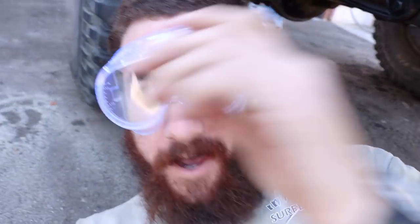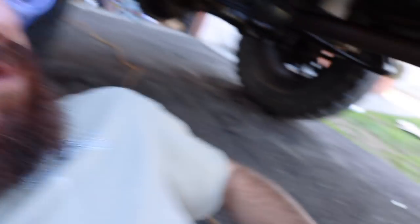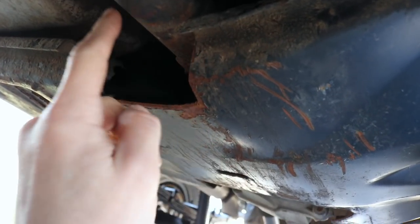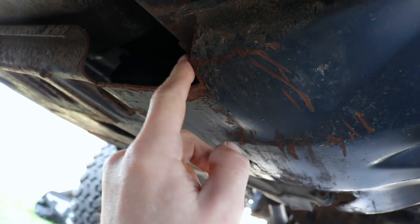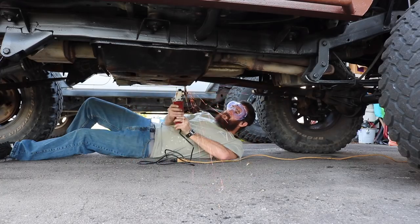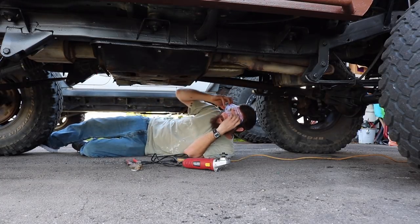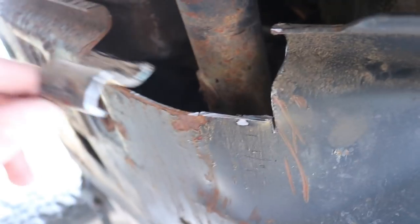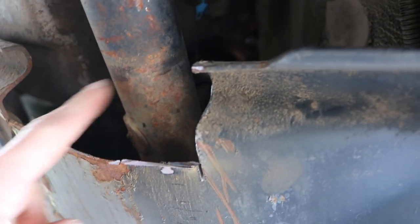Safety first. A while back I took the spacers out of my skid plate, which is also a crossmember for my transmission. A minor issue I've been having is the skid plate is actually now contacting the front drive shaft, so I think we need a little clearancing. I cut this off right here and I think we should have enough room now.